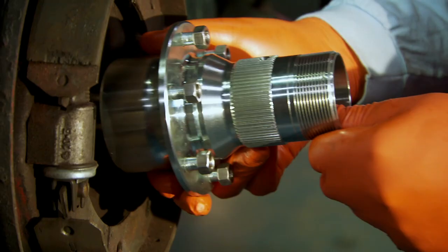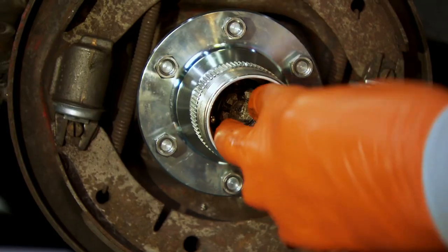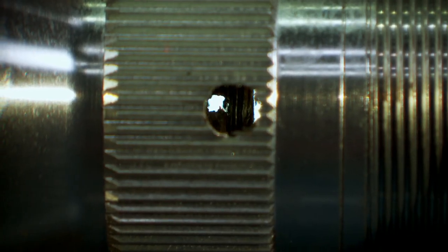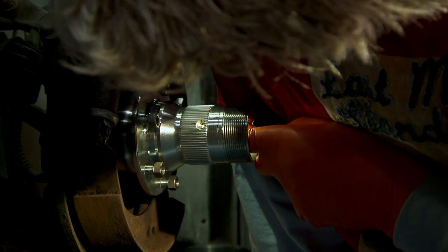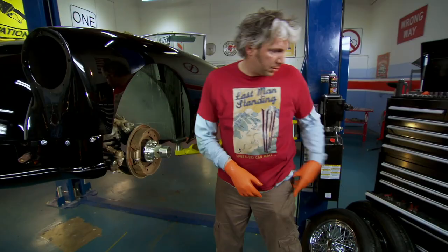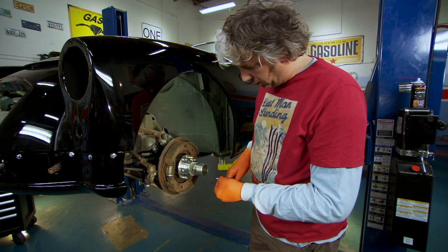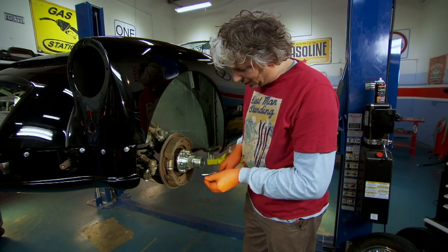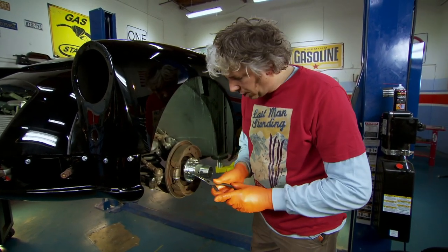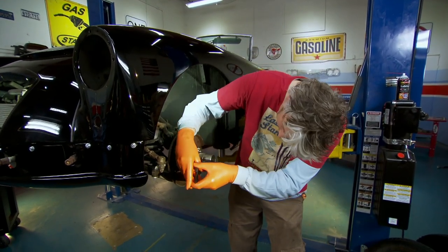The new hub slides into place and is secured using a new bearing, but the old nut. It does get fiddly though. Just want to make sure I've got enough clearance — so that's now nicely lined up. The next thing I can do is get a specially modified split pin, so it's just short enough. Now I've got to try and get this through that hole, through the castellated nut, through the actual stub axle itself, out the other side, and then bend it into position. It's a little tricky, to say the least.